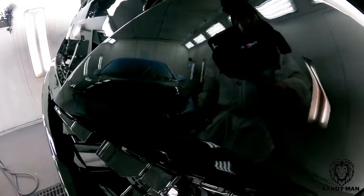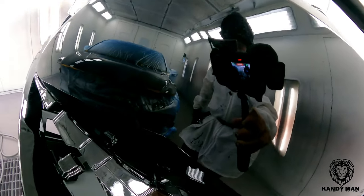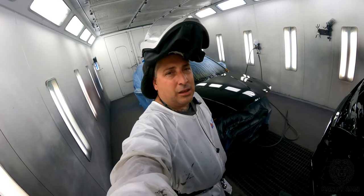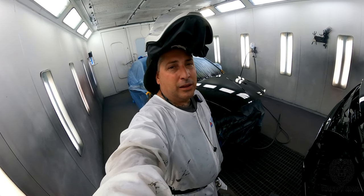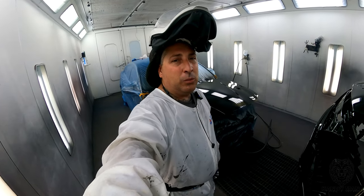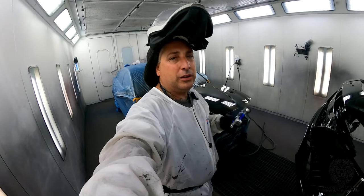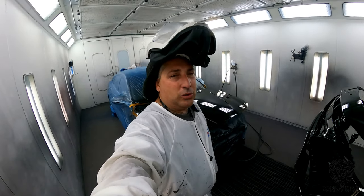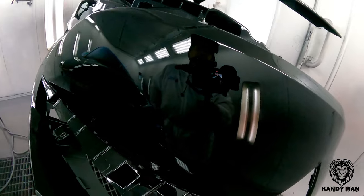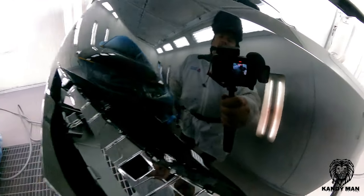Look how flat it laid down that sealer on that bumper. When you get a flat foundation it comes out flat all the way up through the top coat. One of the biggest things guys don't realize is they lay down a bumpy or orange-peeled sealer, then they want to know why the job looks peely. Make sure your sealer and whatever you're painting over is flat, otherwise you start out wrong and you'll be trying to bury it in the clear coat. You can see here with that 1.0 on the Pro Light S — it lays it down flat, and then once you lay down your base and clear, you get nothing but flat.